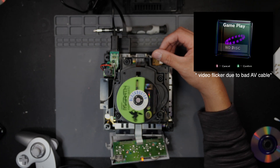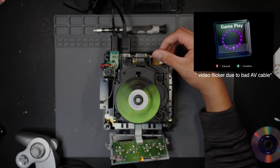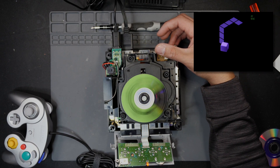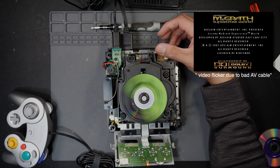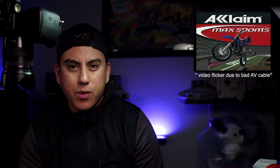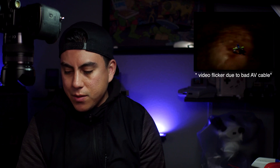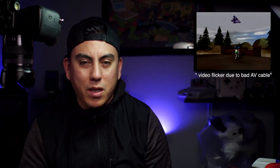It's actually having a little bit of trouble, so let's adjust it just a little more. There it goes, it's grabbing now. I think if we go down just a little bit we can make it a lot better, so let's power off and adjust. We're at 341 right now, so we'll go down to around 300. You can hear it spinning up normally — it should grab right away — and yes, it grabbed right away. We're at 278 right now. Anything below 200 I'd just go with a new laser, but this one has quite a bit of life left — it was still grabbing, just barely, so a little adjustment got it back.